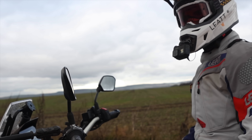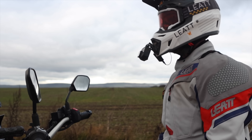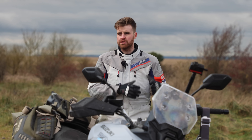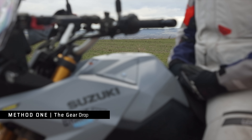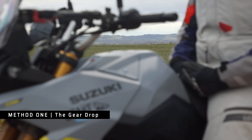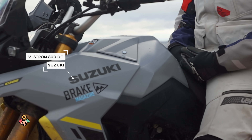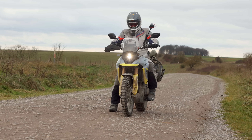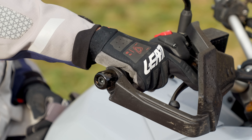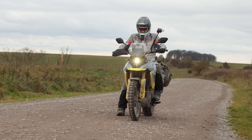Now that we're all set to go, we need to learn to pull away. There are kind of two methods that blend together. The first is the drop it into gear and hope you don't destroy the gearbox method, and the second is to use the starter motor to pull away. On this Suzuki, we can't use the starter motor method — there's some kind of cutout switch that just turns the bike off — so we'll show you method one and describe method two. This method is harsh on the gearbox, but it does work, and it can be done from both a static start and a rolling start. You'll need the bike running and you're going to need some throttle. Gently push the bike down into first gear and then turn the throttle further to stop it stalling and help you pull away. The bike is going to lurch forward and will probably wheel spin.